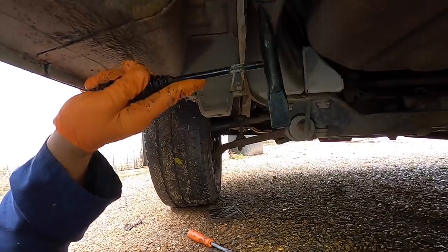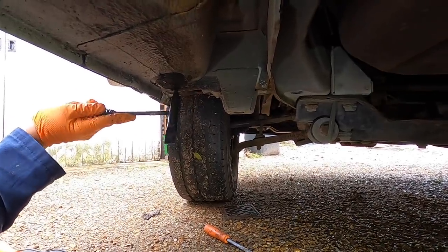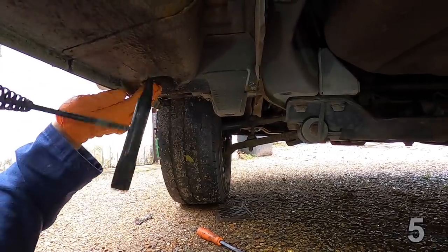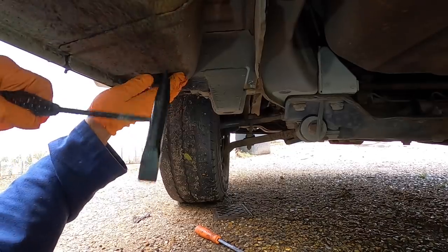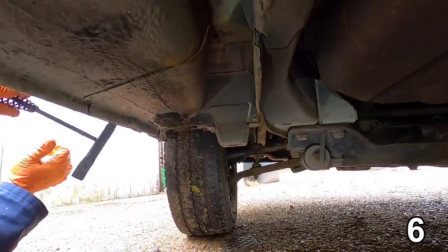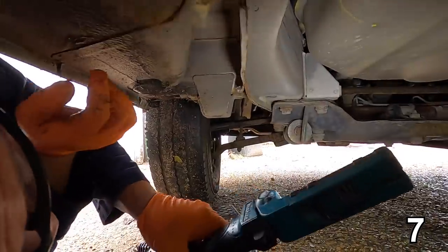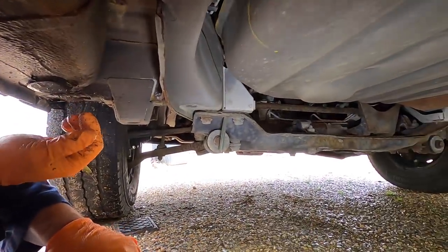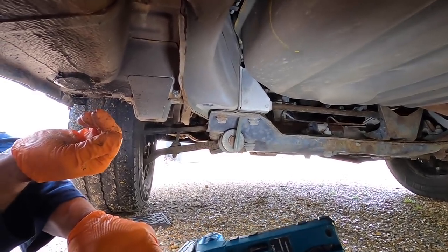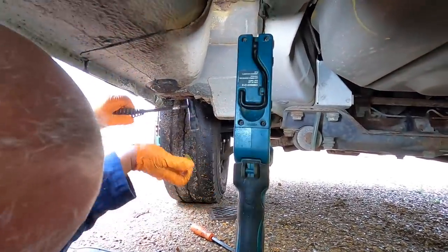You can hear that — that's awesome. It all looks like it's rotten, but it's absolutely solid. You can hear that — that's the passenger footwell. So far all I can see on Herman is surface corrosion, which we can quite easily clean up with a wire brush and a wheel, then get it back to good metal, treat it, and then re-underseal it. There's nothing structural to worry about in there.